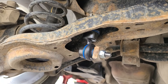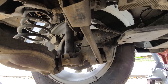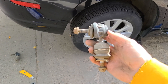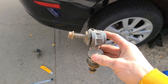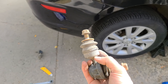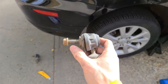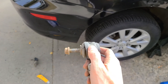I've got the new sway bar end links on both sides, as you can see. Every other joint under here is absolutely solid with no movement. This is the passenger side sway bar link — it's probably factory, as old as the car. This part facing straight up goes vertical and the bottom part goes horizontal, but right here there's movement laterally in this direction.